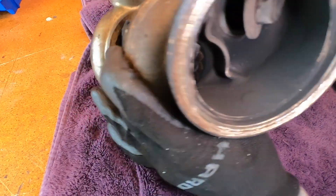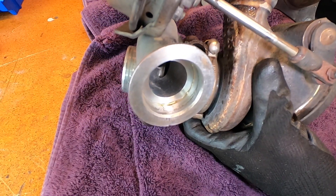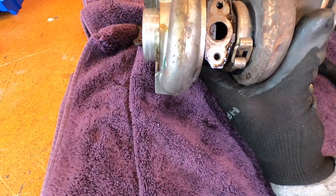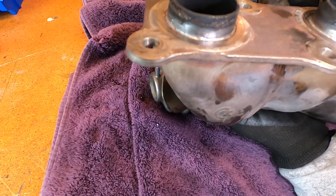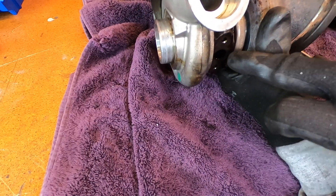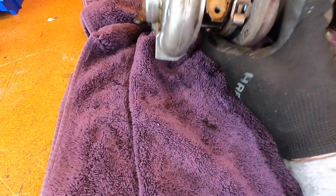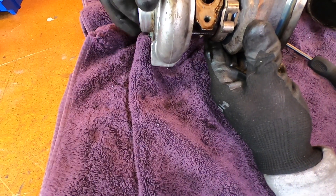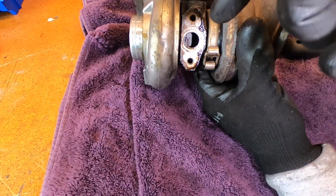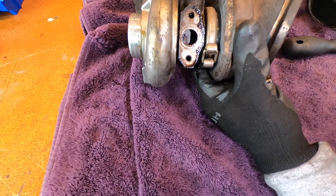Take a look at your coolant passages as well. You can see that the coolant comes in one way and out the other — pretty standard. Oil is very similar: oil goes inside here and it comes out the other end. The outlet is gravity-fed, so it comes in from the high pressure side and goes down to the oil pan. Make sure that there's no dirt inside of here. You can use a magnetic pickup and stick it inside to make sure there's no metal fragments that would otherwise cause early wear.